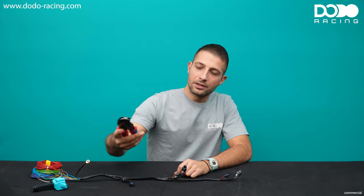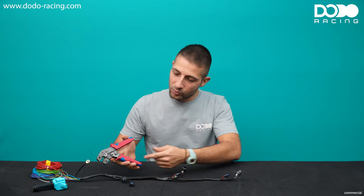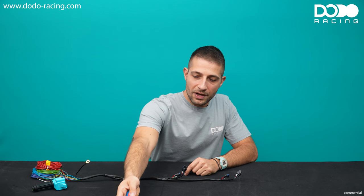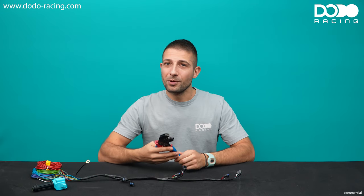The next thing we're going to need is our crimping tool — I use something like this. If you don't have one, please buy one. You cannot make a proper crimp connection with ordinary pliers. You need a tool which is specially designed for crimping, which will give you enough leverage to make a proper crimp connection. And the crimp connection is the only connection we want to use in our car — no soldering, no wire terminals whatsoever. The crimp connection is the only connection which can resist heat and vibration. Once you have this tool, you're going to use it much more frequently than you think.